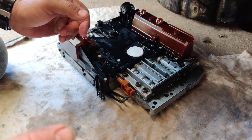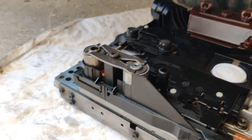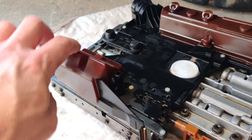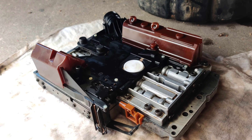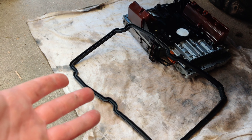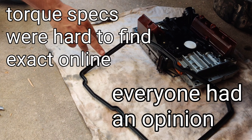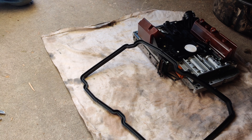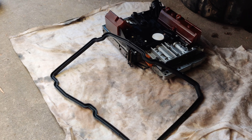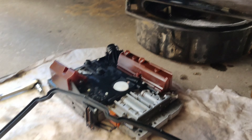Manny went ahead and torqued the springs slightly down to match how they were before — 12 to 15 pounds of torque is the spec on that, and I'll find the exact figure and post it. The covers just snap back on and it goes right back up in there. You've got a gasket that comes with the kit that slides right over the pan — rubber, not cork, so it doesn't fall apart. Torque spec for the oil pan is approximately 27 foot-pounds; I'll confirm and put it in the description.